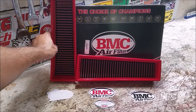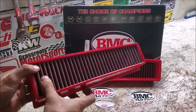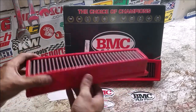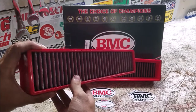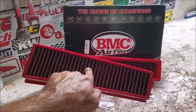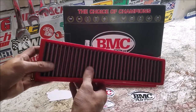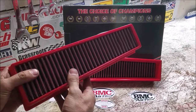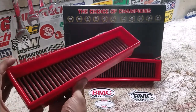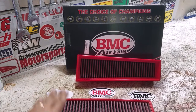We may put a sticker inside the airbox so it's easily seen when someone takes out the filters, warning them not to throw these away — they are good filters. Like any other factory filter it's got a nice mold all the way around, but with a different material inside. It feels like a nice sturdy polyurethane. You've got a weave mesh on the outside to give it rigidity with oiled cotton on the inside — pretty much standard fare for an aftermarket filter, but it looks really nice.